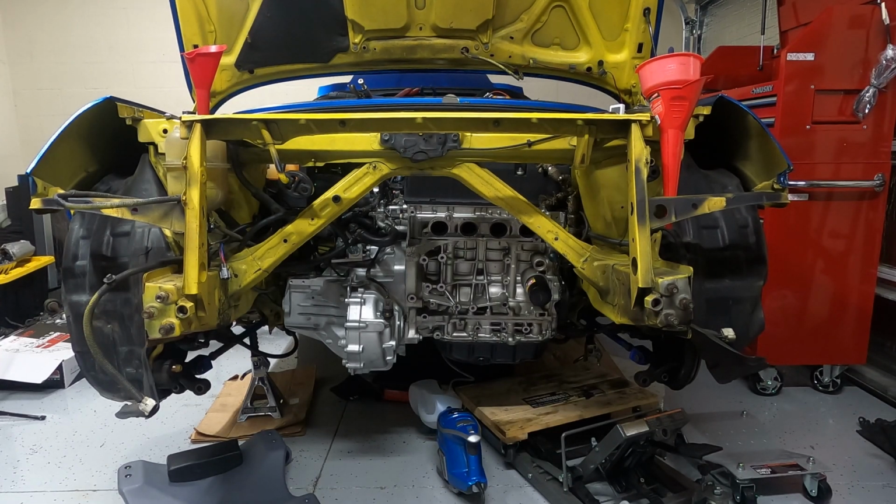I got coolant in, I have oil in, I have clutch fluid in, and for me that was very important so that I could push in the clutch and not engage the transmission, so that I don't have to really worry about the shafts being in. If I have the clutch depressed, the transmission is not going to spin, and so I don't have to add the fluids. I could just test it just to make sure that she cranks and idles for a few seconds with no issues, and then kill the engine and then install everything.